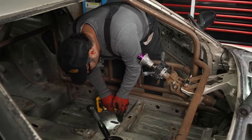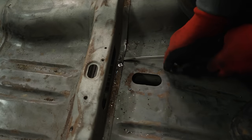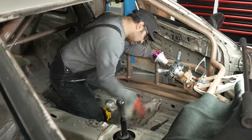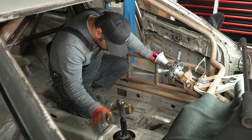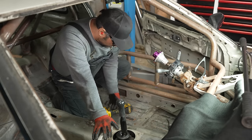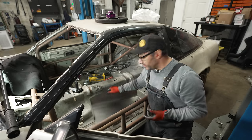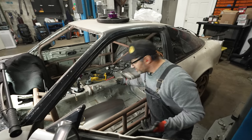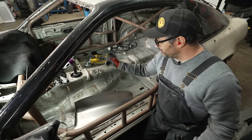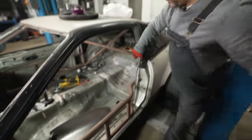Cut right through that one. You can see you don't go too far — you leave quite a bit of metal there intact, which is nice; we won't have to repair anything. So this is the Elaria piece — you can see it's going to lower the floor a solid three inches. It's significant. We have to cut this hump out and fit this sucker in there and weld it all together. We have a transmission bolted in here, so we're going to cut right around the transmission mounts, put it up first, start the cut there and figure it out.